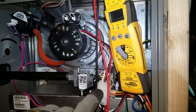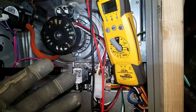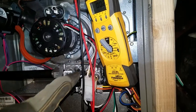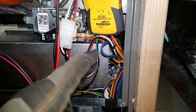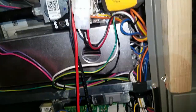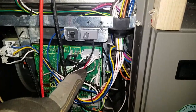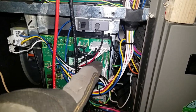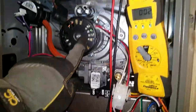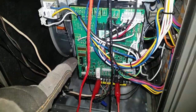When it comes to checking connections, I double-checked off camera. That's how I confirmed it was getting voltage — I just wasn't getting good contact in there. I checked the wire and it's good, not nicked or anything. We're getting voltage, so it's not the circuit board — the board is doing its job. This motor isn't spinning, therefore it's not creating a vacuum, therefore the pressure switch is not closing, and therefore the unit goes into lockout.